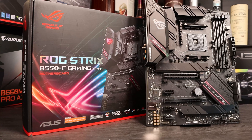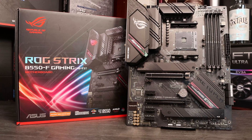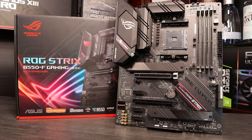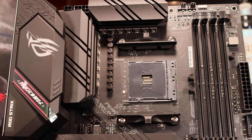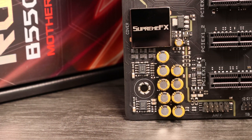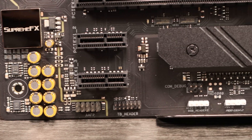Moving up to the higher end, there are a few B550 boards that have caught our eye. However, it is worth considering that once you're past $200 you start to move into X570 motherboard territory, and the additional features those boards provide — extra PCIe 4.0 connectivity on M.2 slots and more versatility for complex or workstation builds — may be worth considering. Nonetheless the ASUS ROG Strix B550F, retailing between $180 and $200, still represents relatively good value. It's got good VRMs, looks great, and has a high quality audio chip on board. The main misgiving is that there's no internal USB 3.2 Gen 2 header, so make sure it's compatible with any case you buy.